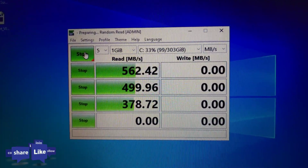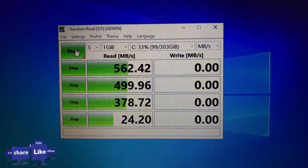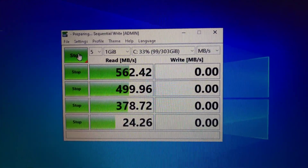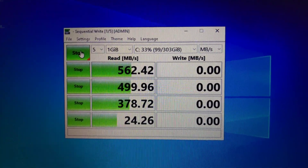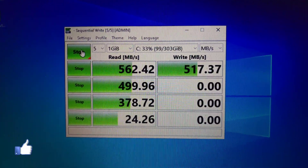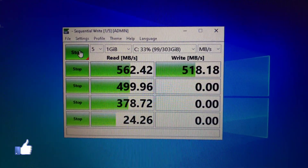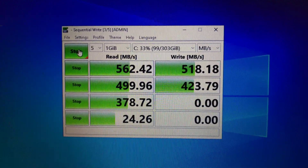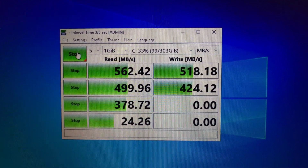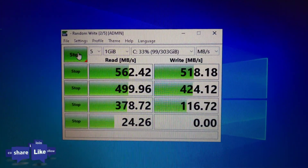When it comes to advantages of this SSD, the main one is performance. Second is the competitive pricing — if you compare it with other SSDs you will get better value for money. Third is the five-year warranty along with very good endurance: 180TB TBW for this 500GB drive. If you go for a higher size like 1TB or 2TB, the endurance goes even higher, which defines the life of the SSD.